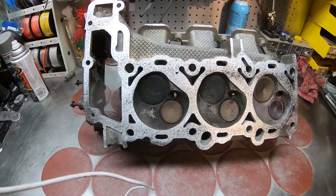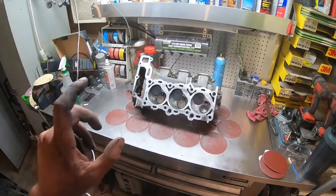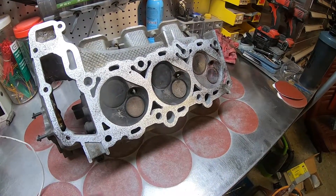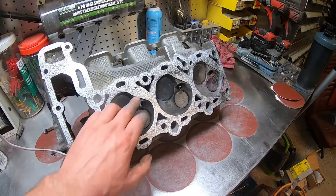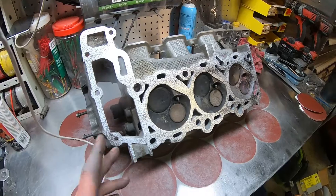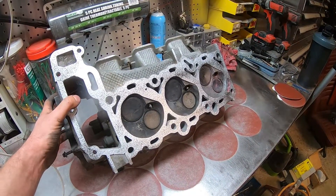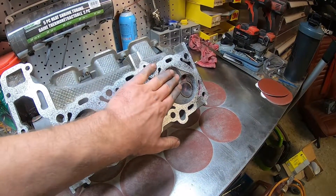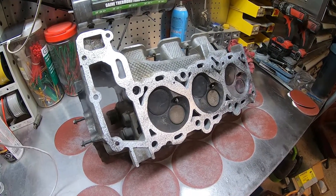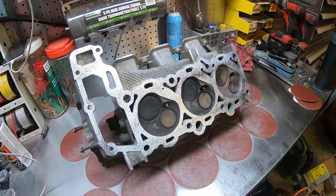Now I'm down to the absolute last step. I've taken a spray can of black paint, stayed back about a foot and a half, and given it the lightest little spatter. Once it's fully dry I'll flip it over, rub it across the surface again, and that's going to show if there's any low spots — any dips and valleys. I think right in here is a little low, and possibly a little bit here. It's really hard to get perfectly flat using the orbital, but it got us really close. Just hand-sand it back and forth — don't put any pressure, or if you press harder with one hand you'll mill it on an angle. You want this completely flat to mate with the deck surface of the block.